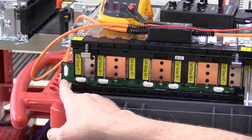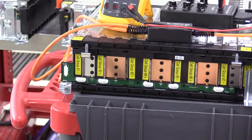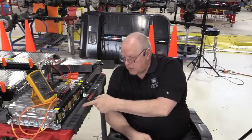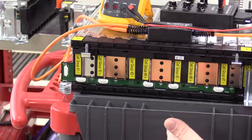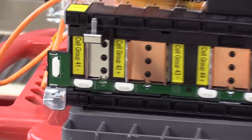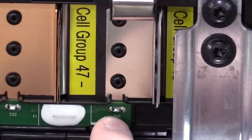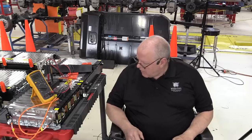Okay, first, this green circuit board right here is soldered to these connections at the end of each set of cell groups. And so if you even undo these nuts, the battery will start to expand, which can break the circuit board. So don't do that. The only way I could figure out to possibly avoid that damage would be to come in and unsolder each of these connections here. So you've got a solder joint right there, another one right there, right there, right there, and right there. 1, 2, 3, 4, 5 of them on this side, and 4 on the other